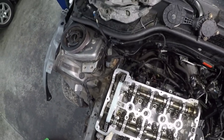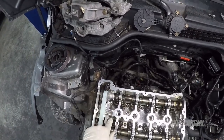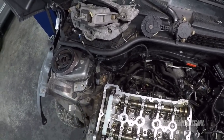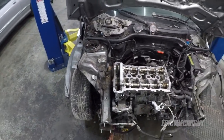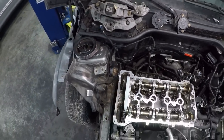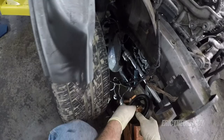I have a confession to make. This fastener right here, I just swapped out with another 8mm fastener. It was stripping out. It goes all the way down through. I just put in a longer bolt. So the old one was stripped and it wasn't tightening up and I didn't feel confident with it. So I just tried that, it worked. Sorry I didn't share that with you. I wasn't sure if it was gonna work, but it did. These were stripped before I got here. If you run into the same problem, a longer 8mm bolt should do the trick. Like I said, these go all the way down through. And if you really get desperate, I suppose you could put a really long bolt and a nut on the other side, although that is cheesy as cheese can get.